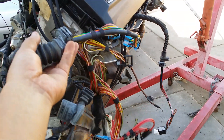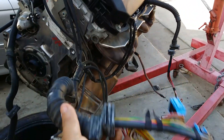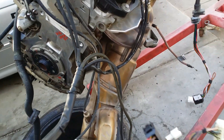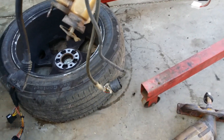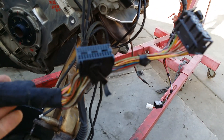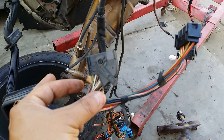The other difference in terms of what makes up the engine is the wiring harness. On a 525, in this model, the wiring harness is complete — what I mean by that is this wiring basically goes to all your O2 sensors, and it also goes to your transmission. It's one whole piece. Then on the side of the engine you have this connection here, which goes to the DME, and this controls the left side of your engine with all these components.